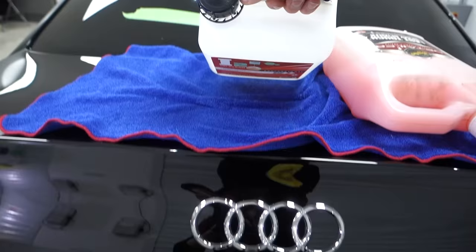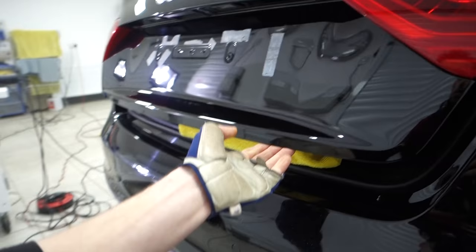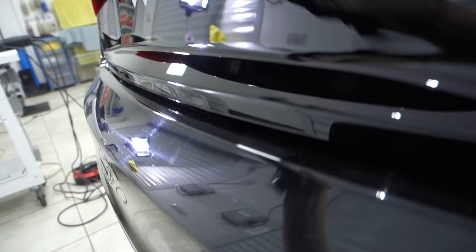And then of course it's just weighted. So I've got two tubs of, I don't know what, I2 tri-clean, just a bit of weight, which is protected with a microfiber towel just to counterbalance the spring action. That allows the boot lid to remain at this position so you can safely come to the edge without risk of hitting the bodywork. Let's just close it too. You're never going to polish that where it is, so you've got to raise it 4 or 5 inches to give you that edge to safely cut. You're welcome.